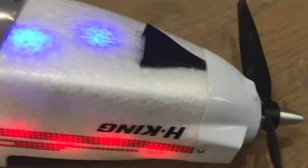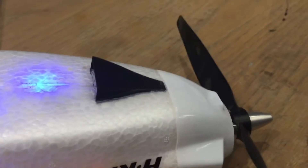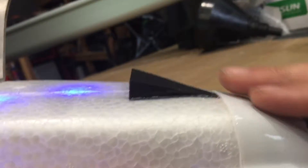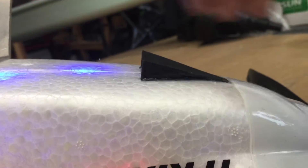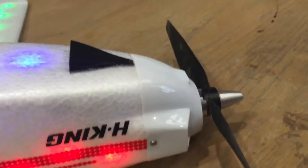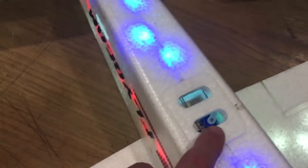So what I've done is create the motor's own exhaust vent by flipping a NACA duct upside down and in reverse — I printed a couple for experimentation. Because of the way the air flows over it, it creates a vacuum behind there, and that draws the hot air out from the motor cavity in the cowling. It should create a really good cooling airflow through the motor.